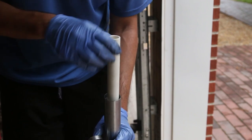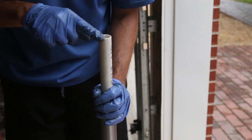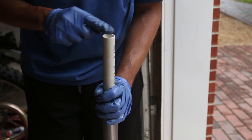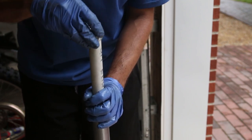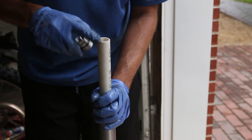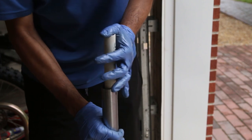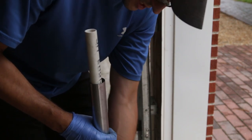The spacer goes in next. According to the fork diagrams there's also a washer at the very top, but whoever previously worked on this bike didn't install one so I'm skipping it. Normally if you have one you should install it, but the cup sits well in the PVC pipe so it won't go anywhere. If you have a stock spacer you may need to use the washer. After pumping the fork several times, raise the fork up — it takes a little more pressure because of the oil.